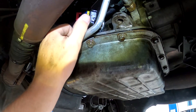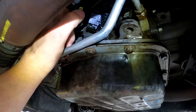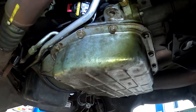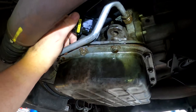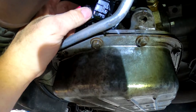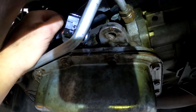This happens quite a bit on pressurized sensors. The transmission is going to have hydraulic pressure anywhere from 150 upwards of 350 psi, and you can see a fair amount of transmission fluid actually coming out of the electrical connector. Anytime we have a pressurized device — such as a transmission, power steering, or engine — these plastic sensors can fail internally and actually start to leak fluid. The downside is it starts to fill the electrical connector cavity with fluid, and then that can wick up the insulation — because the insulation is sealed around the end of the connector — and actually pump hydraulic fluid, in this case transmission fluid, up into the harness.